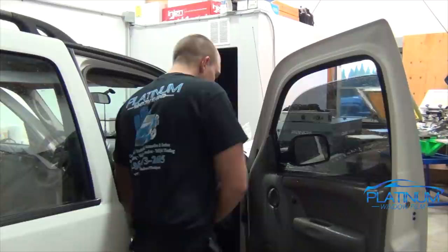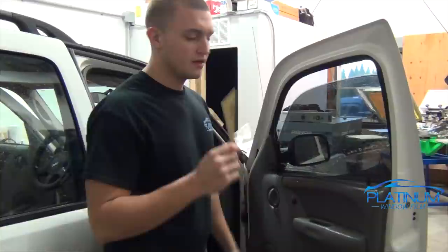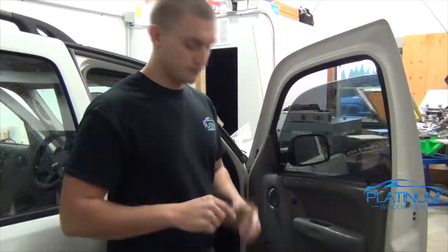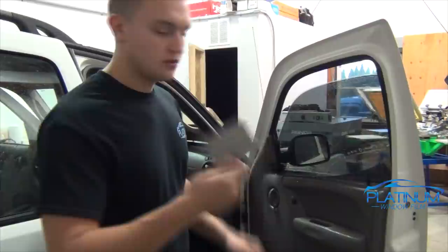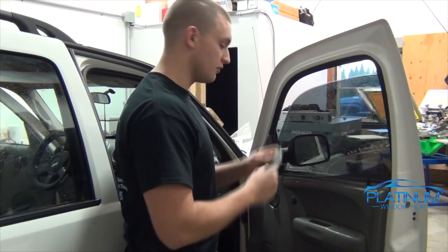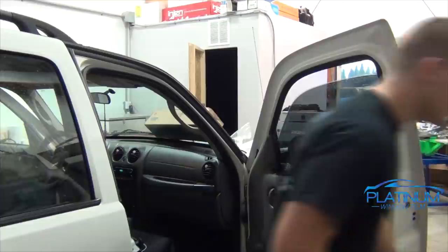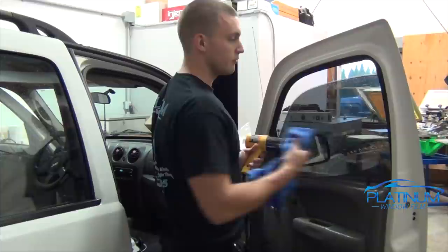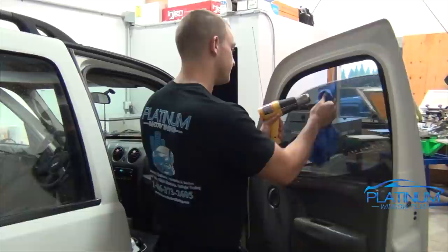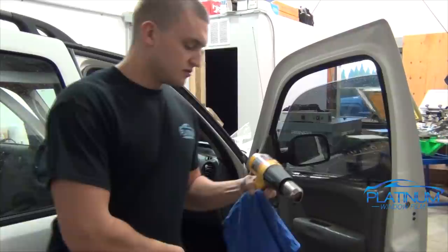I used to use the Easy Reach Platinum or Easy Reach Gold to go from top to bottom before rolling up the window, but I don't like to use that anymore because it is hard and does scratch the film. What I like to use now is kind of like a bondo card — it's a platinum Lidco card. Take this from the top and bring it halfway down the glass. This will not scratch your glass as long as you wipe it before you use it. I'm going to wrap the same card in a towel along with a heat gun to push out the top edge of the glass, removing water and drying out the top edge at the same time. Before rolling the window up, always check the outside of the top edge — just take your rag, wipe the top edge, and make sure everything looks good.